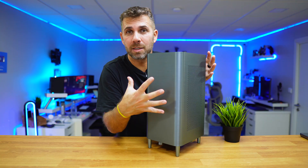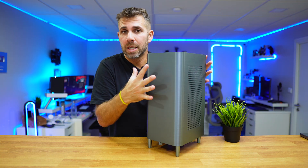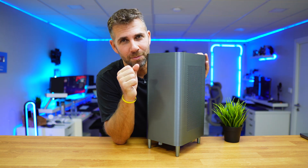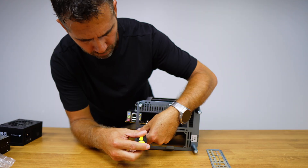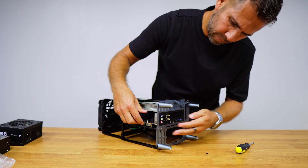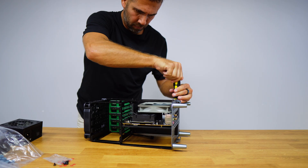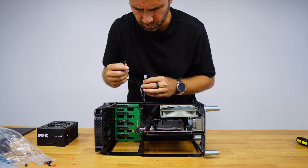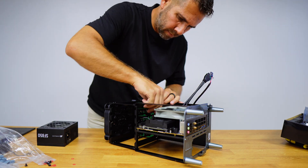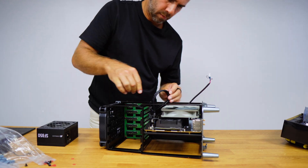So if you are building a system with a really small footprint like this one, this combination of motherboard and fan is really awesome. To install the board I had to remove two screws to pass it through, but once it's in place it looks great. We just need to install four screws to secure the board and then connect the case cables to the board to keep things tidy. Despite being small, this case and motherboard combo is not difficult to work with at all — the experience was really cool.